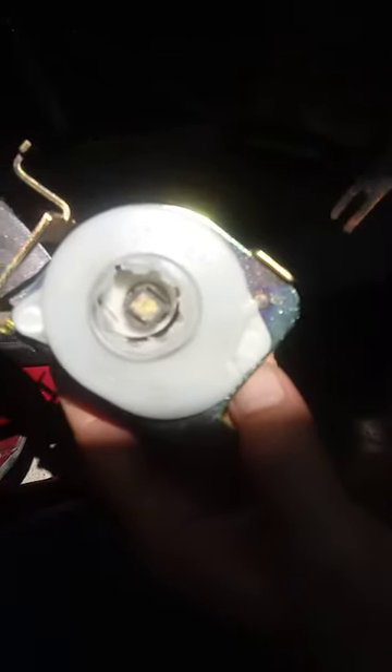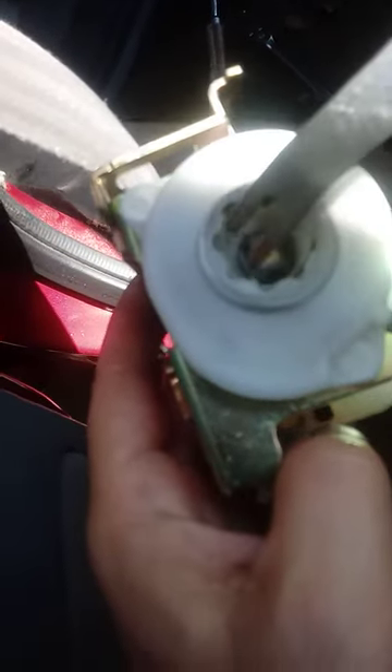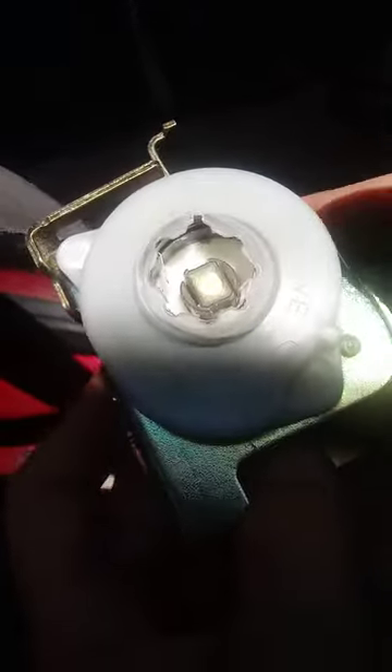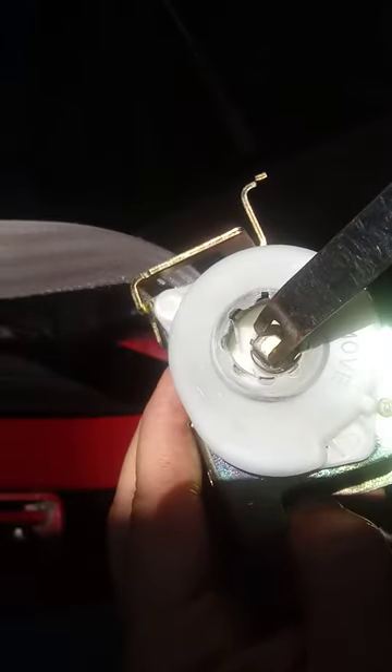In this Chevy Caprice, and many Chevrolet cars of the 90s, the seat belt is not retracting. The reason is this cap here — it's a very soft, flimsy plastic that cracks and falls off, failing to secure the spring. There is a spring here that hooks up to this groove, and the tang of the spring goes into that groove.